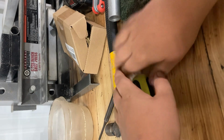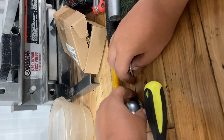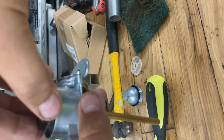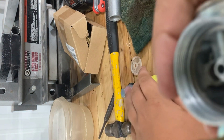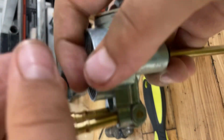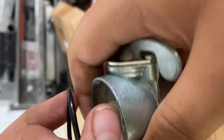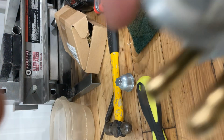All right. So next, grab your metal gasket once I find it. Metal gasket goes in like so. Careful. Drop it in. Sitting down there nestled in the bottom. Next goes your filter. Oh, drop it in, like so. Make sure it's good. Next goes your O-ring. See how I have that in there so far? Here's your O-ring. You wanna see that? Drop that in there.